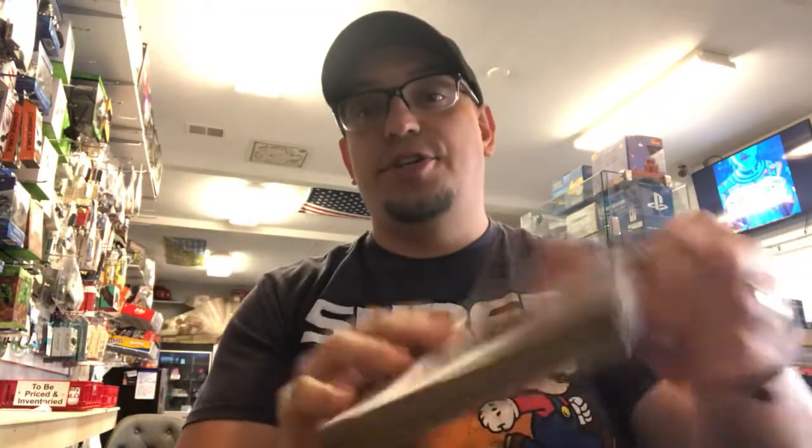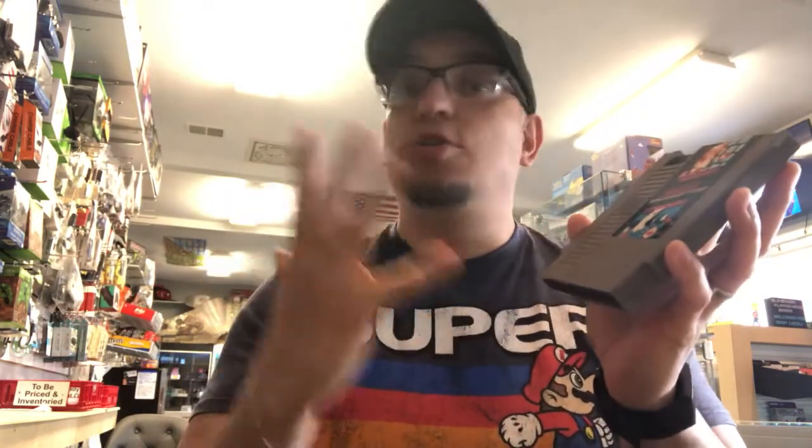So you recently got back into retro gaming, mainly the Nintendo Entertainment System or the NES. But sometimes when you put games in, of course, they don't play 100% all the time. A big cause of this is because the contacts on the inside of your cartridge are dirty. So an easy way to fix this, or just simple retro gaming 101, is you want to clean these contacts on the inside, but you don't want to use soap or water.